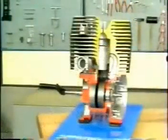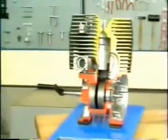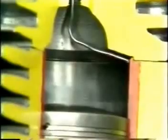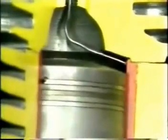Gap determination is demonstrated by means of a sectional model in this case. The gap is determined by means of a 2 mm thick tin wire fitted between cylinder head interior and piston crown. Guide the wire to the cylinder liner. Turn the piston through the top dead center to flatten the wire for value determination.